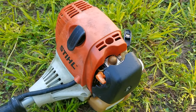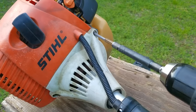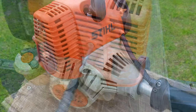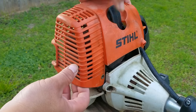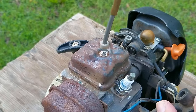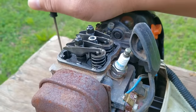Unfortunately at the moment it's not going to start and run, but at least we know it has the ability to run, which means we can continue with the diagnostic. Now it could be a carb issue, but in the years this thing has been in service, it's never had the valve lash inspected, which is a huge maintenance issue with this particular engine. The valve lash is the clearance between the rocker arm and the top of the valves, and this clearance is very important when it comes to the timing of when the valves open or close. So we need to remove the top cover, followed by the valve cover, put one rocker arm in the down position, and then check the other rocker arm to see if the valve lash is out of spec.